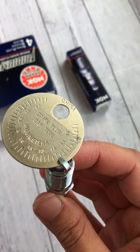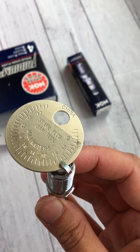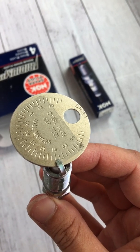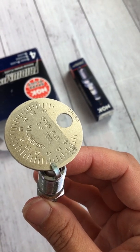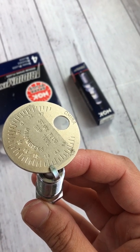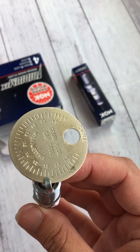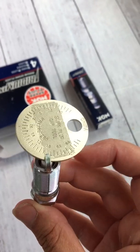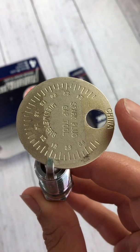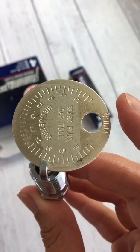The gap I need to run is around 0.66mm - slightly modified, sitting at about stage one plus at the moment. So I need to be down at 0.66 and the plug is way over that straight out of the box, so I'm going to reduce that gap.